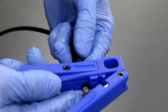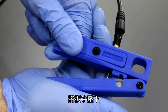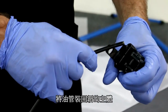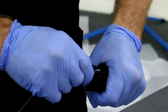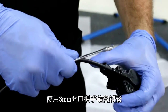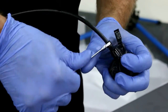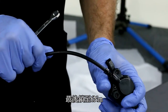Slide the hose through here, hold the hose, and then press the insert all the way in. Sliding it back out. Now let's install the hose into the new caliper body. Using an 8 millimeter spanner wrench, finish by torquing it down to 6 Newton meters.